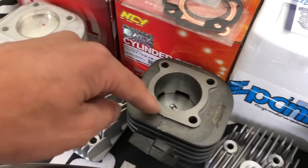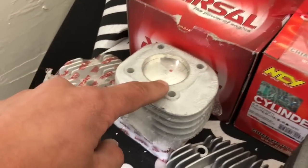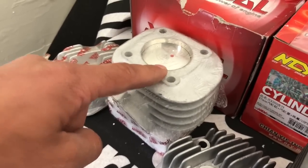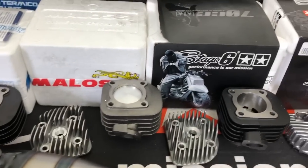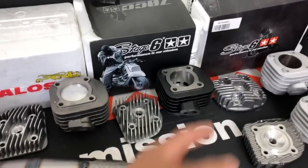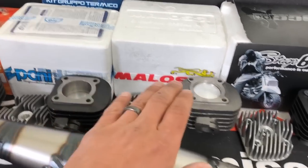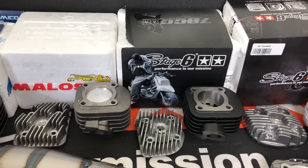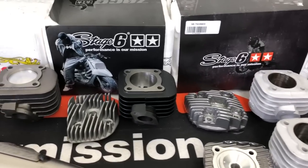Chris Thaxton runs the MK2s, Sheldon Abbey runs one of the higher-end cylinders and that bike is reportedly wicked fast. We ran the Stage Six on the Adley as a dyno test in one of our videos. If you need help setting up packages, give us a call or email us — that's kind of our claim to fame. Don't waste your money shooting at random stuff and putting it all together. If you're going to spend money on a build, make sure your pipe, cylinder, and carburetor are properly fitted to each other to get the most for your money.